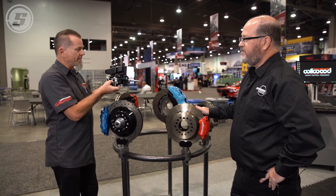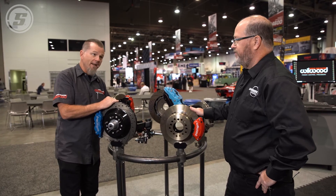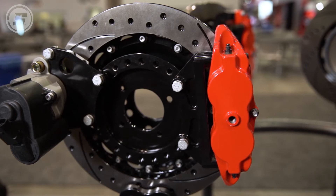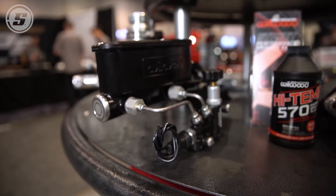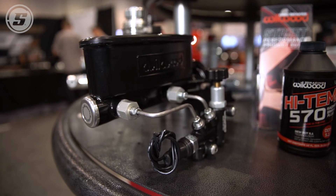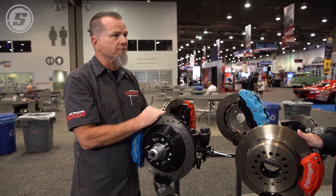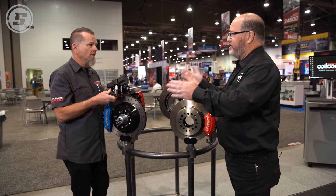The next question is: if you've got a hot rod with a floor-mounted master cylinder and a four-wheel disc system, you have to have a 2-pound residual valve front and rear, because the calipers are going to force fluid or dump it back into the master cylinder — especially if the car sits for a week or two in the garage. There's no way to stop gravity. If you have drums, you already know you need a 10-pound residual valve regardless of master cylinder height. Drum brakes must have 10 pounds of residual pressure. You would plumb a single 10-pound for the rear and a 2-pound for each disc in the front.